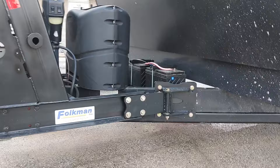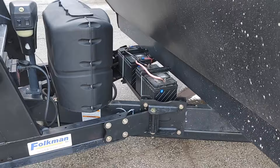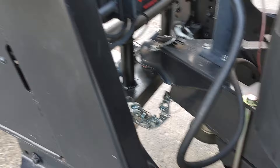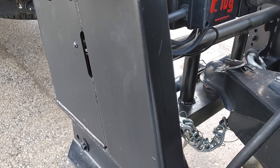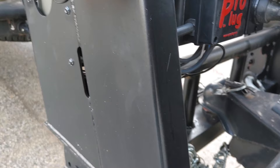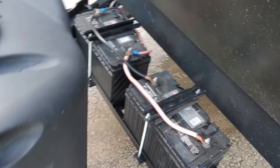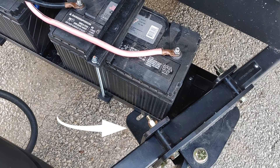The other bracketry simply clamps on to the hitch — there's no welding involved. There's plenty of adjustment for different styles of hitches. You can see how it clamps in the front, and then the ball hooks on to our cross piece. That cross piece can adjust down farther to accept A-frame hitches that are either centered or below. There's also an adapter to catch the battery tray.